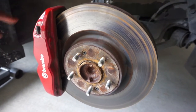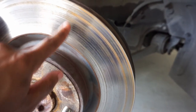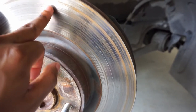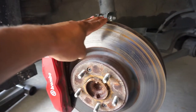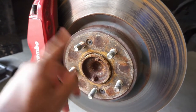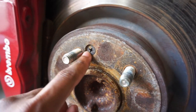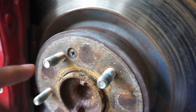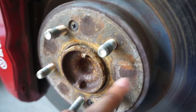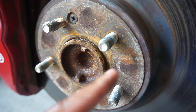Next I have to take off the brake caliper and sit it on a little bucket so it's out of the way. Looking at these rotors, I need new ones — you can feel the grooves and there's a lip that shouldn't be there. Something I learned from doing the other side: be very careful not to strip the Phillips head screw on the rotor. You can beat around the face of the rotor to shock it loose — the rotor and screw will break apart easily. I learned that the hard way.